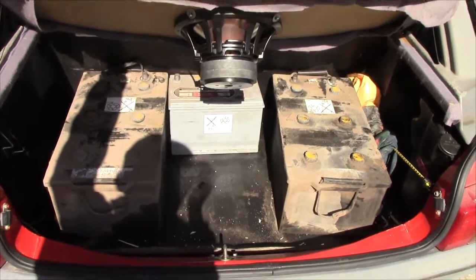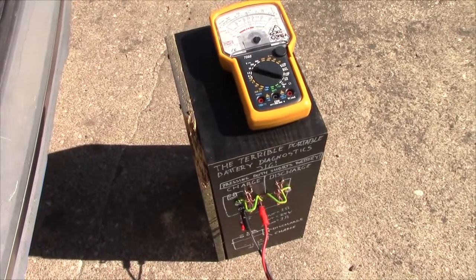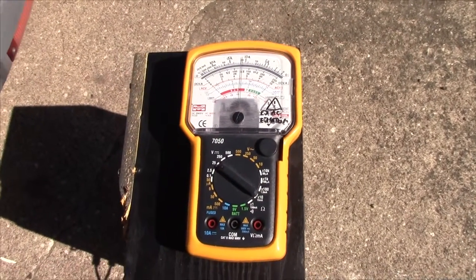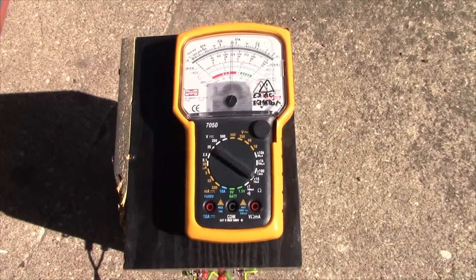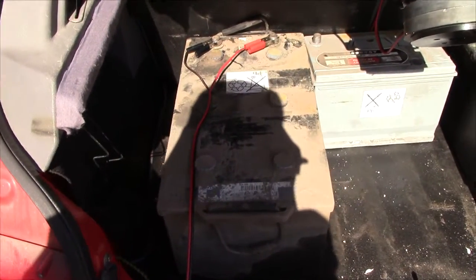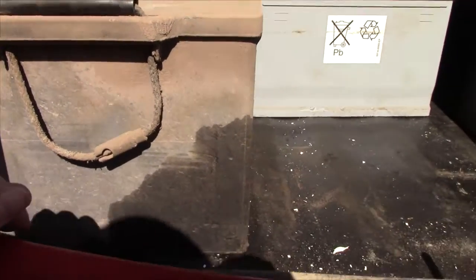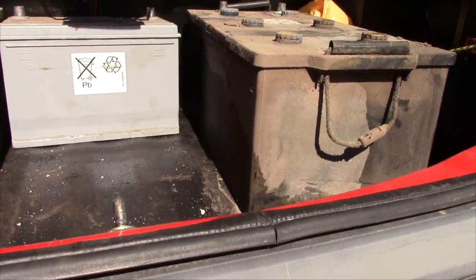Batteries! So I brought my new toy to town today, and boy did it work perfectly. I diagnosed maybe 6 batteries with bad cells and one or two which just wouldn't take a charge. But these 3 guys seemed excellent, despite these 2 having a bit of a deformation on the sides. And I had a look inside the caps and they seemed to be quite sulfated.